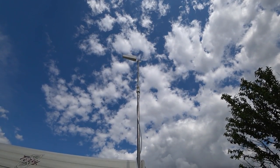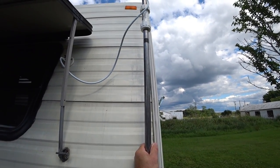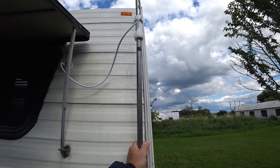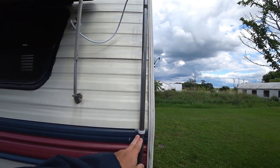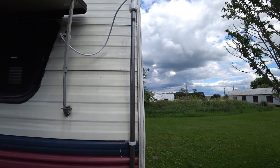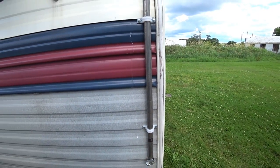That's how the directional antenna got mounted, and then I ran the cable down that comes with the WeBoost 4G RV version — the 4GX or 4GXRV. The main thing was just getting it to clamp up against the side of the RV. The plastic clamps aren't very strong, so I made a bracket for it to rest on, and then put a hose clamp on to keep it from turning in the wind.